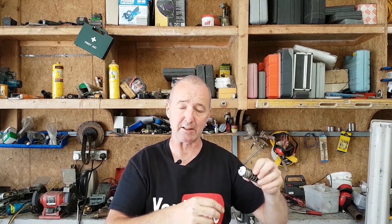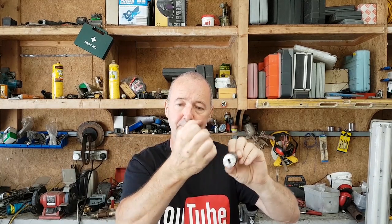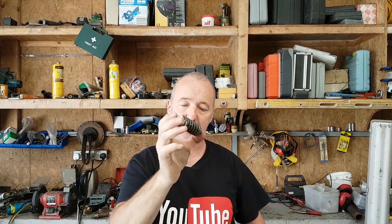What I've seen on YouTube so far is people are having trouble getting it back in. I'm going to try something. I don't know if it'll work out or not. What I'm thinking of doing is compressing the spring, putting a zip tie through the rings on the spring, tighten up the zip tie, let the spring out, and it should be shorter than normal. And if that's the case, then it should be easier to drop it in, and then simply cut the zip tie. That's the plan. Let's see if it works out.